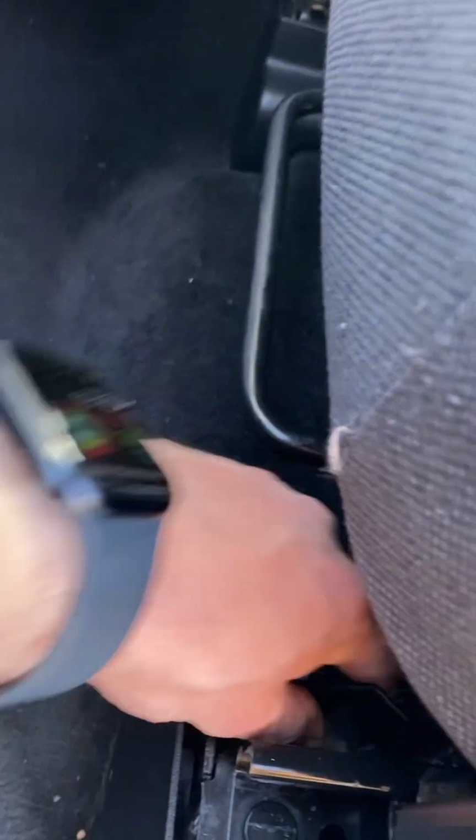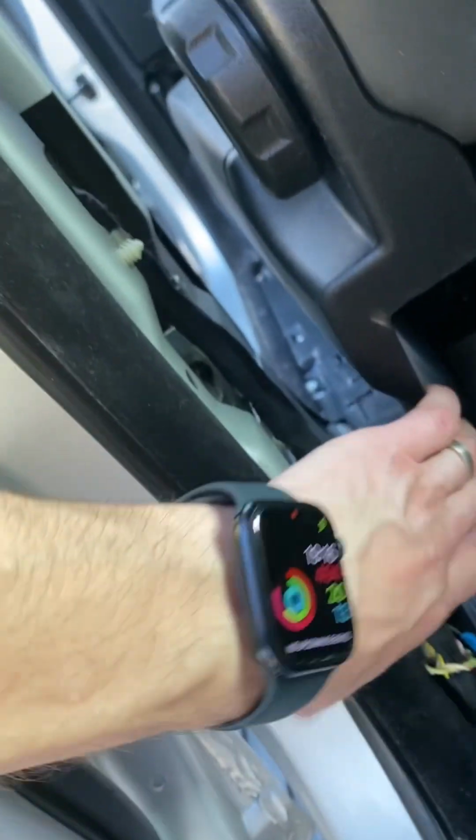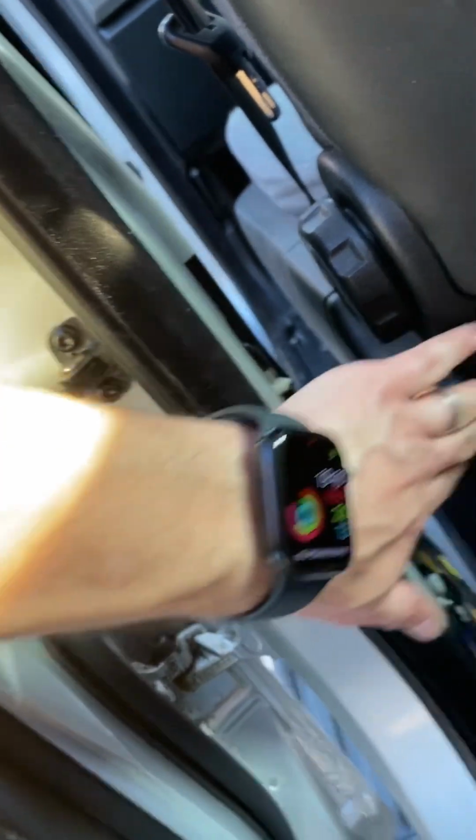Now I've started. This panel comes off quite easy. You pull this out. You can pull these off. We've got these metal clips here, which I found quite awkward. If you struggle with those metal clips, a pair of pliers on the inside here did the job well for me. That's where it comes in, look. And then I had to pop this off and get a screw out of the back there. It was really awkward to pull it out past this, so I'd recommend if you can take this off, take this off. I really struggled taking this off, pulled everything out. I think there's a screw that I couldn't find, so I managed to struggle with that.